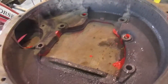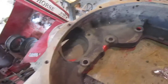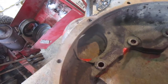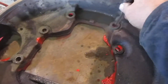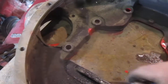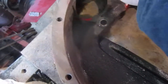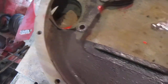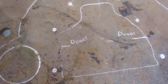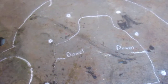Bell housing removed, sitting on my flat plate of steel. I'm taking a marker and going around the outline of the bell housing, marking the holes with my pen. And doing a rough outline of the hole that has to be in the bell housing, and also just a rough hole of the starter housing. I've transferred that over to my steel plate, and I have a rough idea of what size the bell housing has to be.